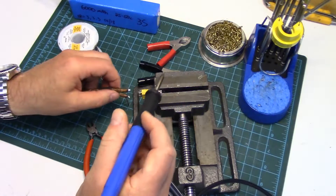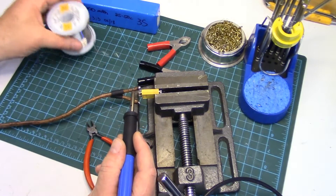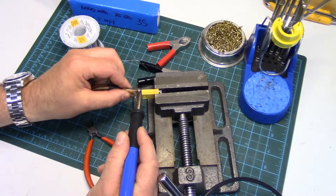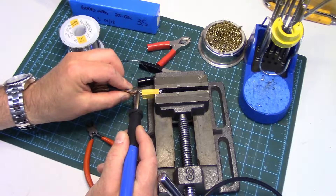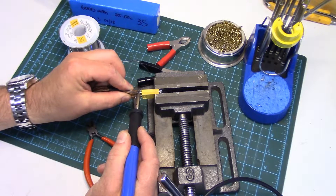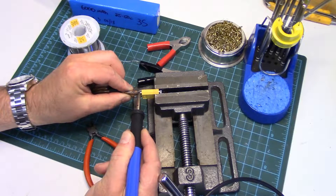3S is pretty much perfect voltage for that — fully charged it's 12.6 volts, so it should work. I'm suspecting a lawn tractor probably only draws 50 to 70 amps while it's starting, so this 6,000 milliamp hour pack should be fine.